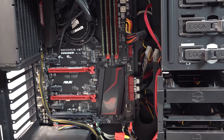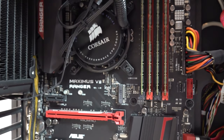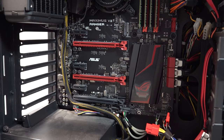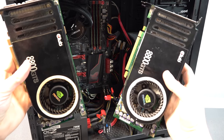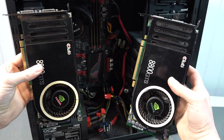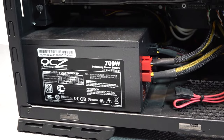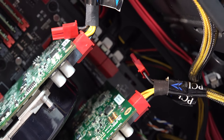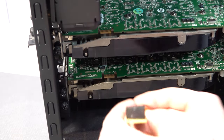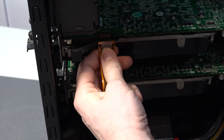I bought two of them specifically to do an SLI setup. I especially bought this MAXIMUS VII RANGER board because it was compatible with older GPUs — newer generation boards don't have SLI support. Finding the right Windows version, the right drivers, and the right video cards is absolutely a rabbit hole. The test PC comes with an OCZ 700W power supply, and the convenient thing with this 8800 GTS is that each card only needs one six-pin connector.